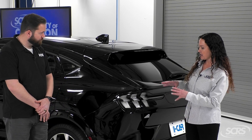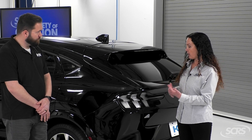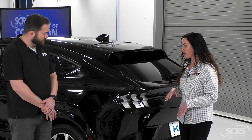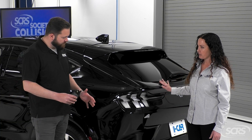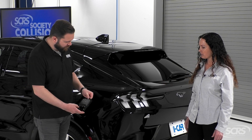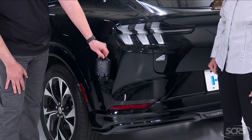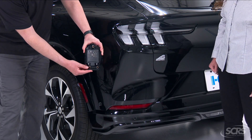So Kurt, on this board, can you tell us what parts make up the system and how they work to keep the passenger safe? So on this car when we're reversing, the automatic emergency braking in reverse is really relying on the rear blind spot modules. On this vehicle they'd be located right around here, behind this rear bumper, attached to the quarter panel. You can see that this module is mounted on a bracket and it's got some curvature to it.